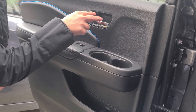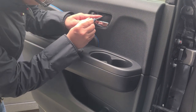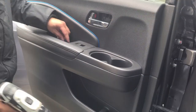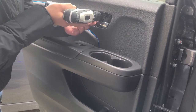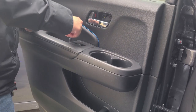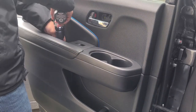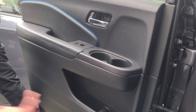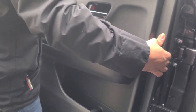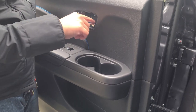For the rear, you have two screws here and one screw here that you have to remove. I'm going to go ahead and remove the cover, then remove the other cover. Same thing — you want to go ahead and pry the door panel out. And you want to remove the door handle.